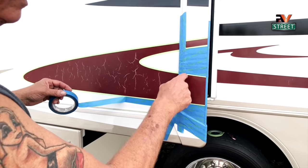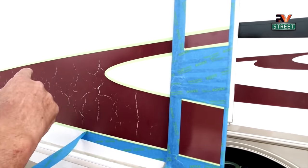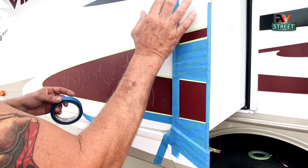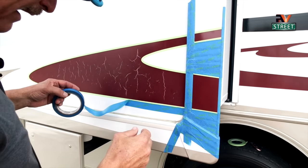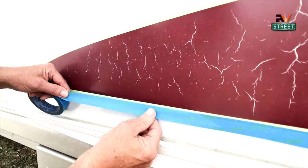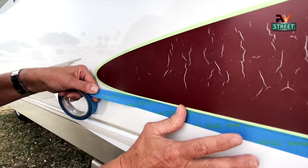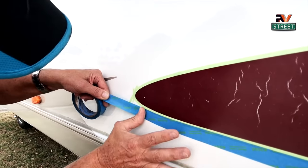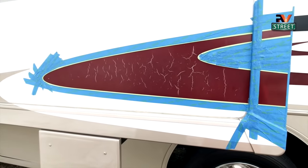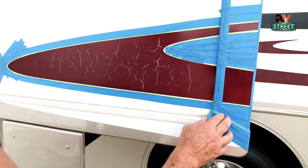You can see how I've finished all of the quarter-inch detail tape to totally go around the border. Now I'm applying the blue tape because I want enough width to put paper beyond it. I just start the blue tape and overlap it on that green tape, and keep going. This gives me a wider border to put my paper on and tape off the motorhome from overspray. So now I have it outlined with green tape and then another overlap layer of blue tape.